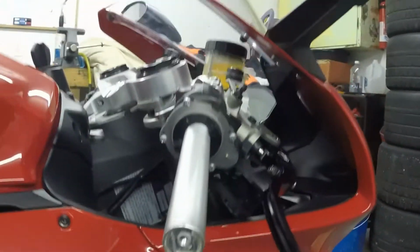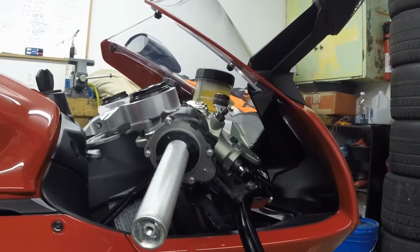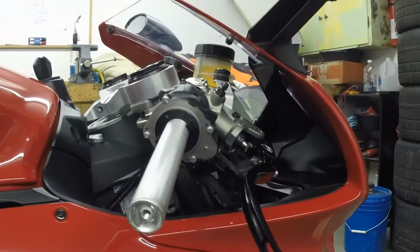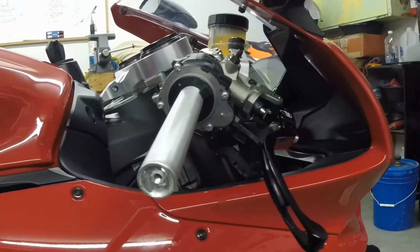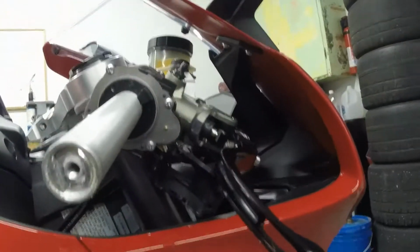I have already tried this a couple of times with the spring, heating it and trying to detension it a little bit, but that has failed. So my next step is I'm going to build my own spring out of stainless steel TIG welding rod, and we'll see if that works. So the next video you'll see will be this removed.